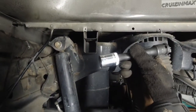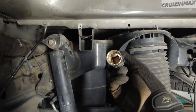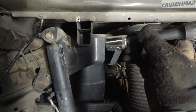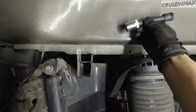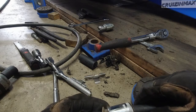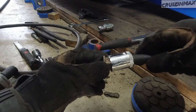On the other side I used a 21mm 12-point socket — six-point will probably not work — on an extension with a ratchet. I was able to grab a hold of it and it actually grabbed it like this, and that's how it came out.